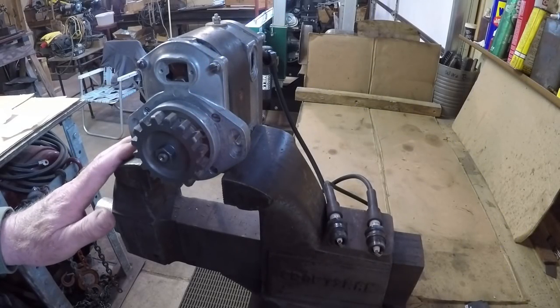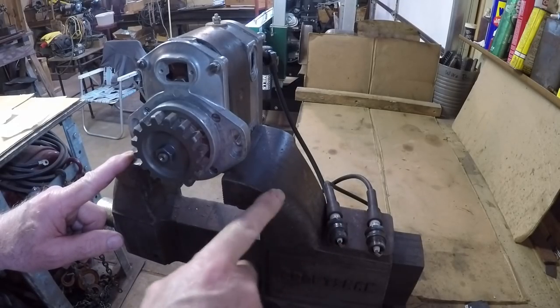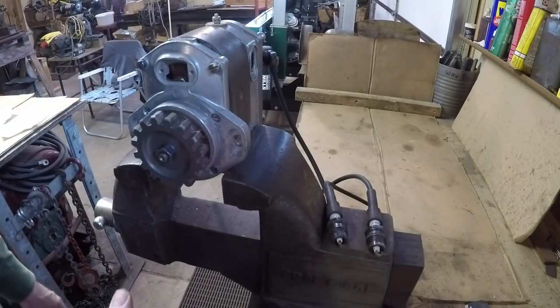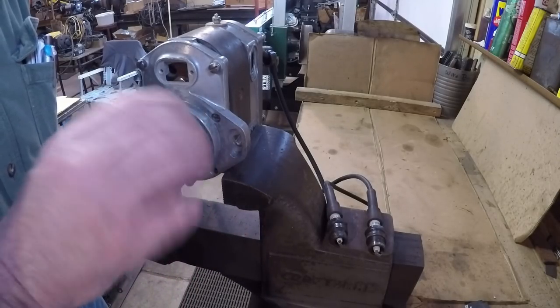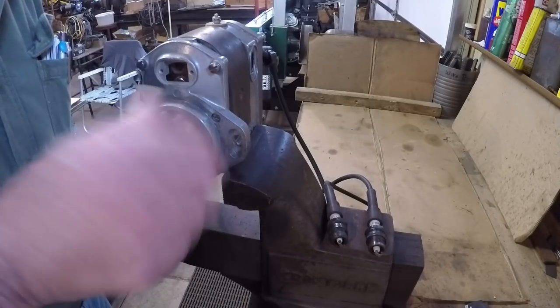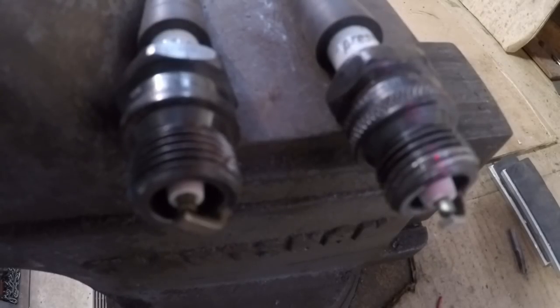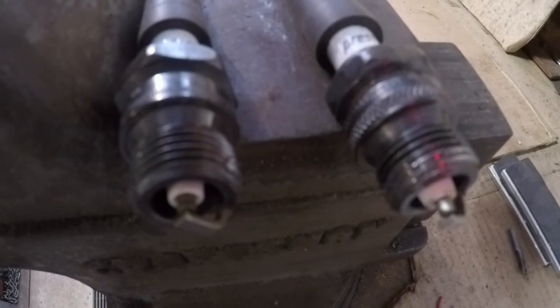Here I've got the mag mounted in the vise, just clamping in the steel jaws and grounding the spark plugs to it — which should be enough grounding to make that spark. I'll give her a turn and see if we can see any spark. Remember, this is that iffy coil and I'm not real sure — you guys are doing a first view just like I am. Oh yeah — good spark! I'll get you in closer so you can watch. I'll give her another spin. This is just spinning by hand and every time she goes by she sparks. It's looking good to me. I like it.